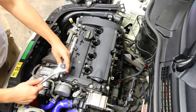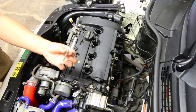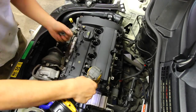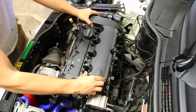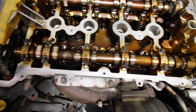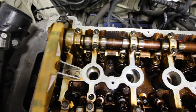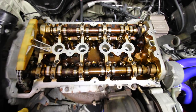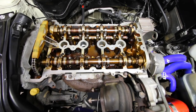With the wiring harness removed, we can finally take the valve cover off. There are 13 10mm bolts total holding the valve cover onto the cylinder head — 11 around the perimeter and 2 in the center. With all 13 removed, lift the valve cover straight up. Looking into the cylinder head you can see the exhaust cam, valves up front, the timing chain along with timing chain guides to the left, and on the backside the intake valves, springs, retainers, and everything. We'll continue disassembly to find the exact culprit.